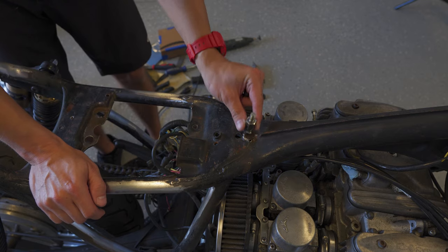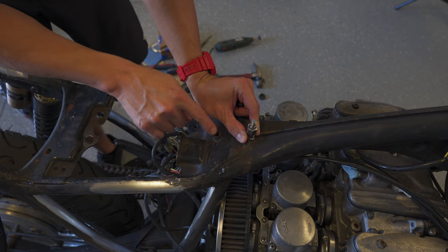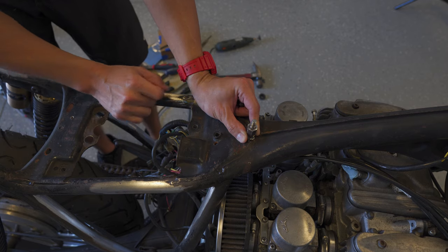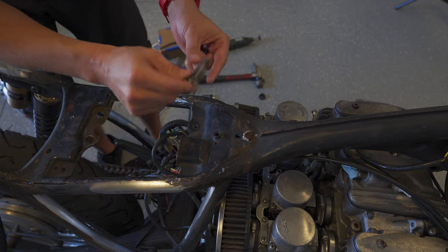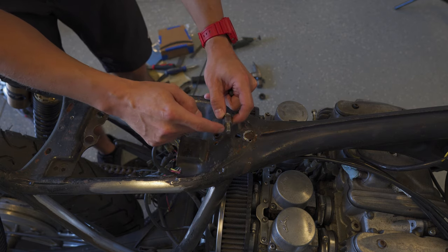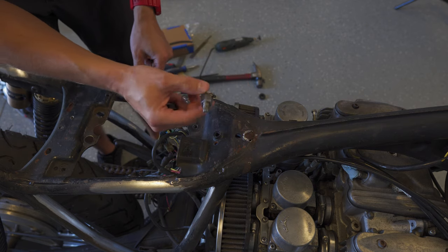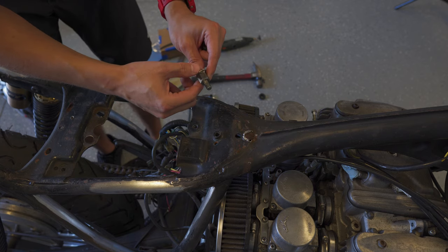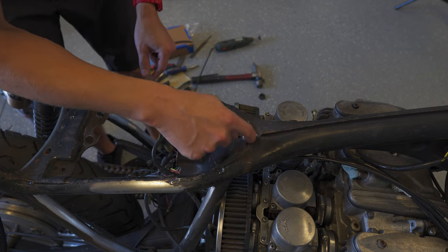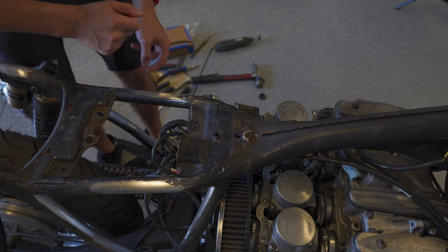Previously in the back they had a piece welded here that secured the tank, but now the tank's moved back and I think I can use this threaded hole here for my mounting — I just need to figure out how to make it work and get enough rubber support so it doesn't vibrate. Something amusing: I'm pretty sure this piece is actually from a Honda CT70, the piece that goes across the shock tower to mount the exhaust. It's funny that it seems to follow me from my CT builds onto this one. It came off pretty cleanly; I'll spot-weld the little hole and grind it clean.